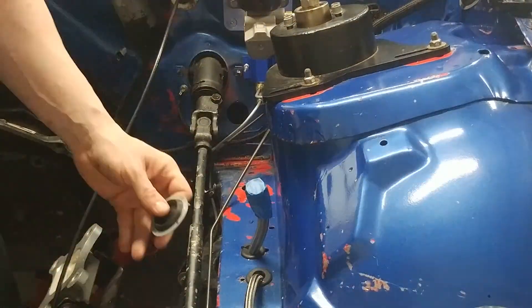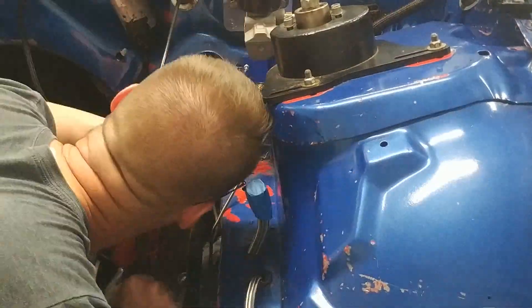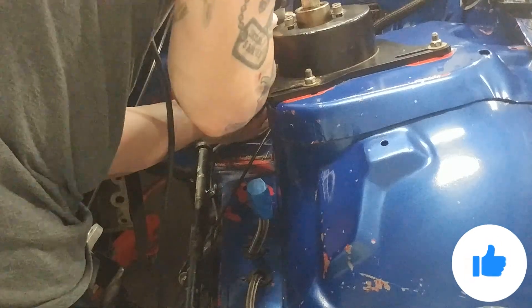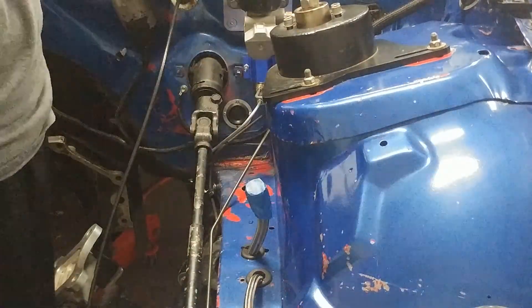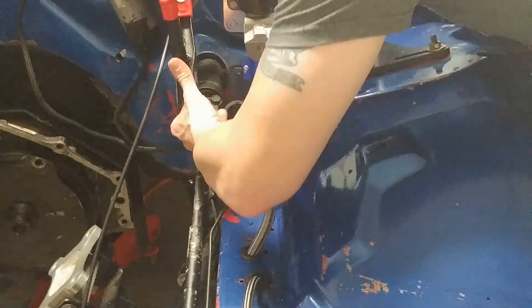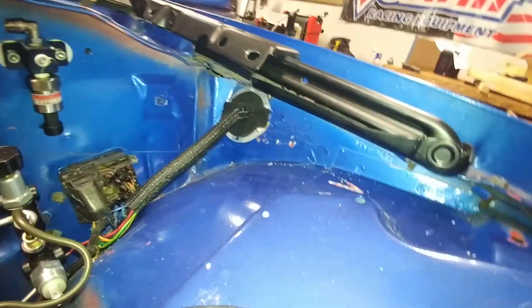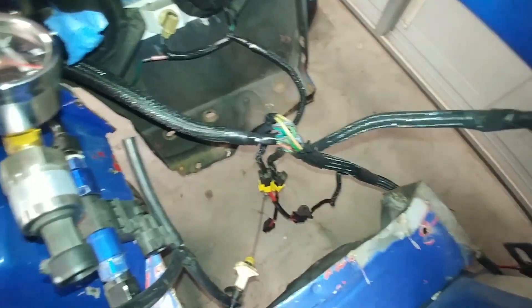There is a roughly one-inch hole just below the steering column and I'm not sure what it's for — maybe it was originally for the clutch, but I don't know — so we're gonna go ahead and seal that up with four rivets. Drill that last one, climb out, and get that rivet from the other side. Here we are — a nice pan shot showing the completed job and how I secured the harness on the underside of those fender wells, and another pair of grommets that didn't make the original shot.